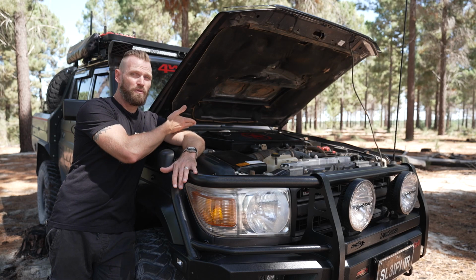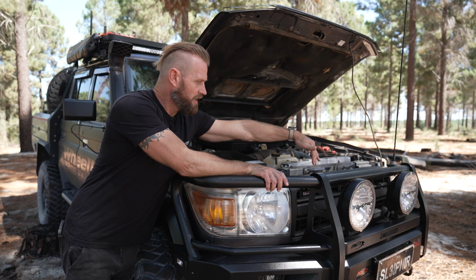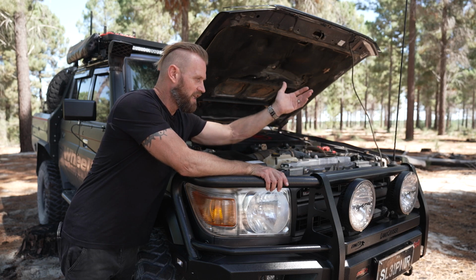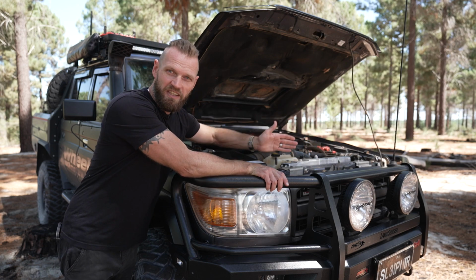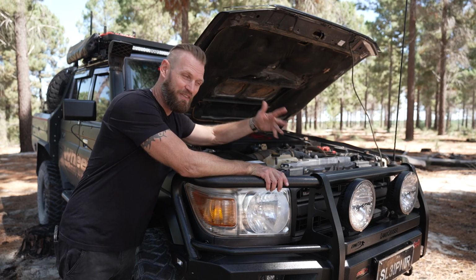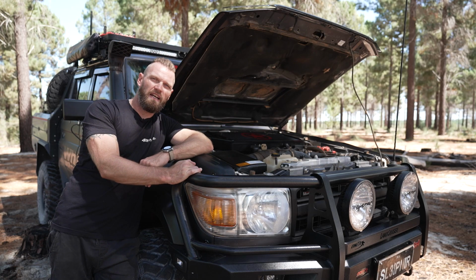Bo, you asked why I didn't go for a front mount and I went for a top mount. Toyota designed the vehicle for a top mount. That's reason number one. Reason number two, I didn't want it to be at the front here being the first thing that will cop a stick or bugs or birds and things like that that sometimes make it through your grill. I'd rather have the aircon condenser sort of grill being the first thing protecting the radiator, if that makes sense. So I'm happy where it is, and I'm happy how the motor is, and that's why I haven't tickled it anymore.